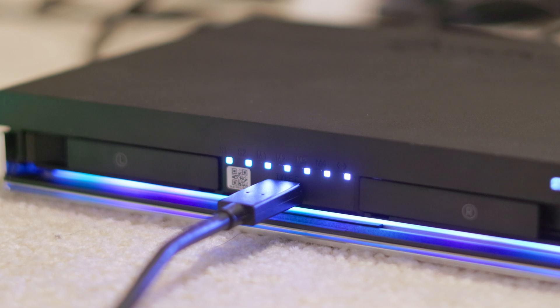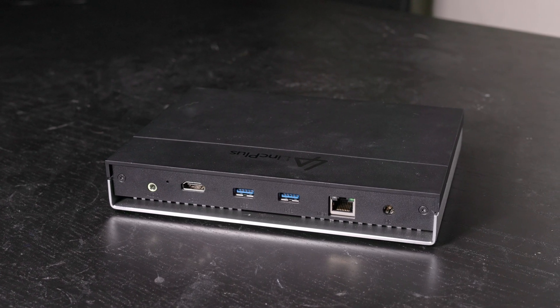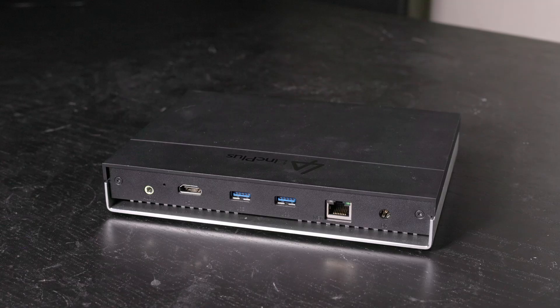Ports-wise, I think this unit was pretty well balanced. USB Type-C is nice for boot storage or copying files, and HDMI and USB ports are nice for management and first-time setup. You're probably going to use the 2.5-gigabit port for the majority of use. 2.5-gigabit makes sense — 5-gigabit probably would have been a nice upgrade you could mostly take full advantage of, but 10-gigabit probably wouldn't be used very well, especially with Unraid, which in a lot of its operations only does I/O to one drive in its default array setup. For most users of this system, 2.5-gigabit is probably going to be enough.